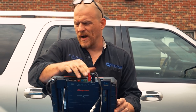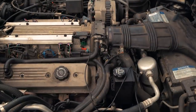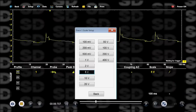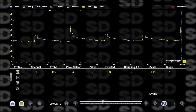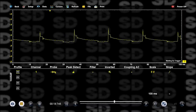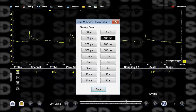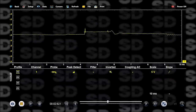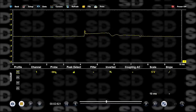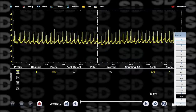We're gonna go on the coil wire with this. Hopefully we get a decent signal. Injector's plugged back in. It's one crappy looking waveform here. But is it enough for me to see what I want to see is the question. Let's set this for detail. Pause that. Zoom. Caleb, reach in, shut that off, please.